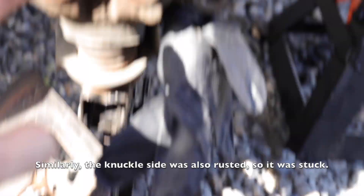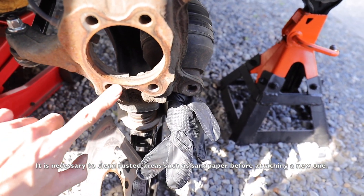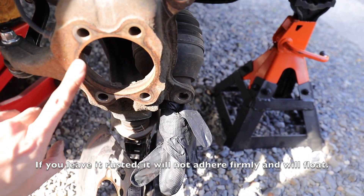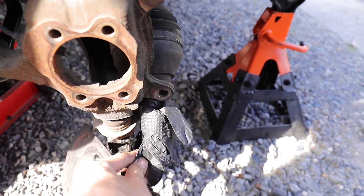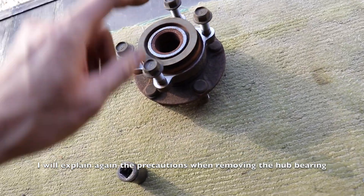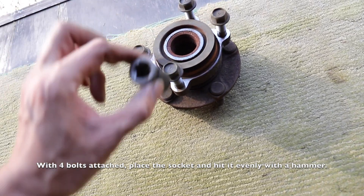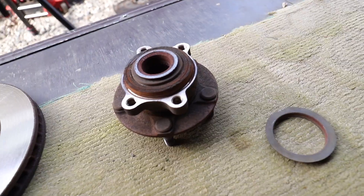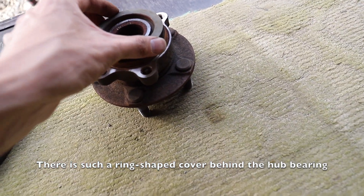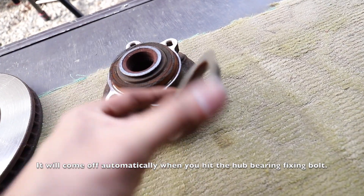This area is very rusty. When installing the new part, sand down the mating surface — remove that rough rust. When tapping it out from the rear, fit all 4 bolts and apply a box socket so you can tap evenly and it should come out.